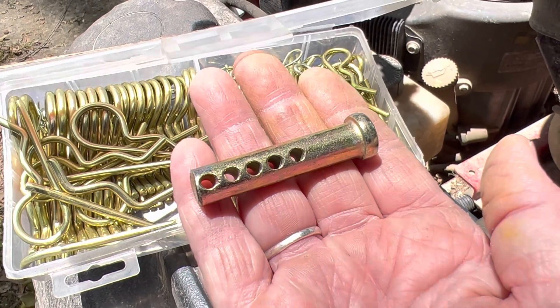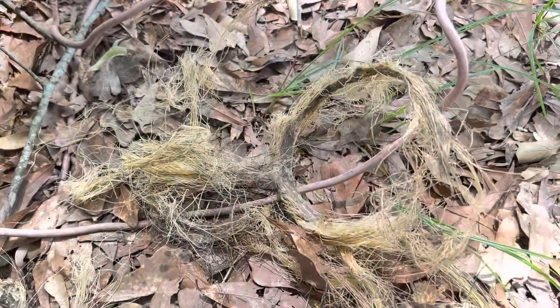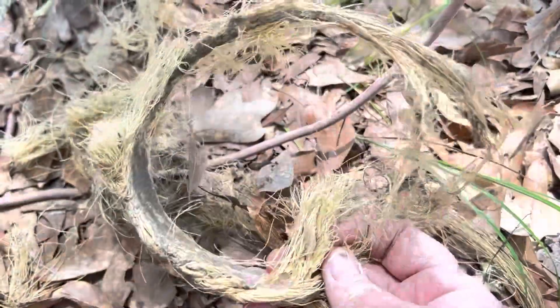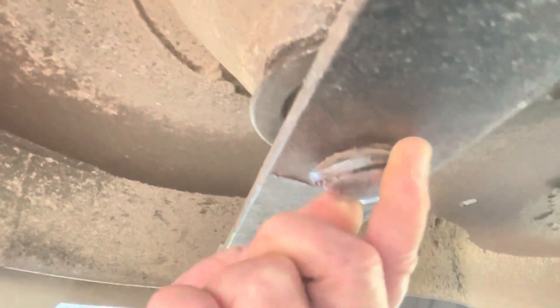If I cut off that rope off that blade, I think my riding mower may be ready to go. I need to gas it up, get out there and make sure it cuts good. Well, I got it — it took me a while. It was a bunch of little pieces to pull out. See how it was just ensconced up in that little part where it tangled up. But of course, nothing's easy. Even though I cleared out the clog, the blade itself is very wobbly. I obviously need to tighten that bolt there, but that bolt is kind of melted — melted, I guess, from the heat of that string being caught in it. So I've got to figure out if I can even get a wrench on that bolt to put it back straight. That's my next task. Ain't nothing easy.